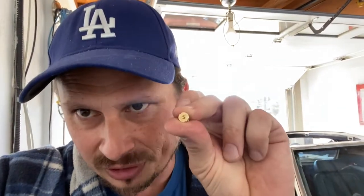Remember, any time you're doing any kind of tests you have to do it with the airbox on — whatever setup you're going to have, that's how you test it. In our case we've got mild aftermarket exhaust and a stock airbox. I like having the stock airbox because it makes the scooter last longer. So we've got a stock airbox and the 70cc big bore Polini kit, which calls for 10 percent more jet.